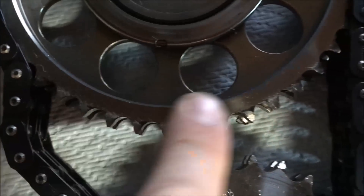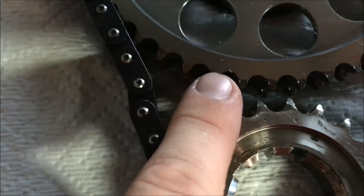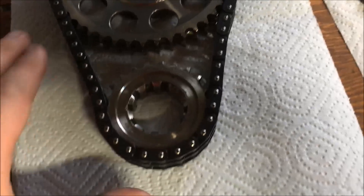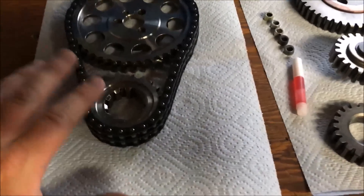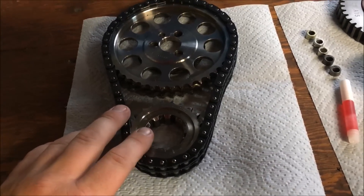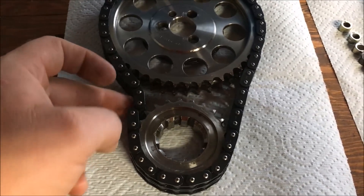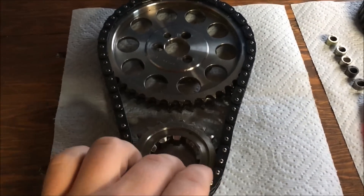This one's been run pretty hard back before when the motor was built before I'd done it. But if you look at it, it's really not in bad shape. It's got a little bit of marking, but that's not abnormal at all. This is actually in rather decent shape for how hard it's been run and the miles that are on it. These provide a little bit of flex and don't transfer quite the engine harmonics that a gear drive will. With double roller timing sets, they tend to last longer, don't stretch as much, and the roller bearings inside on the chain don't wear out the teeth as much and cause variance in timing.